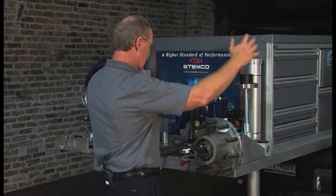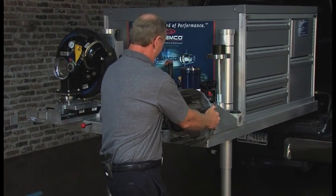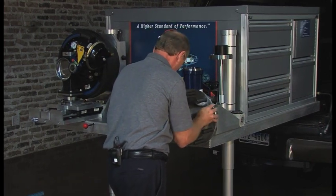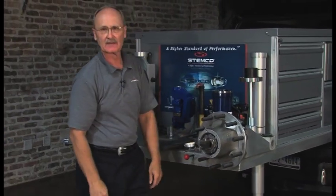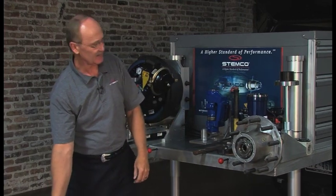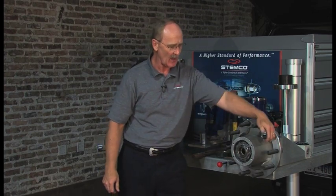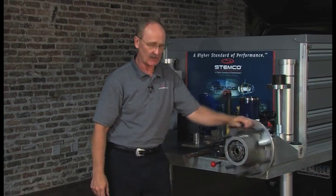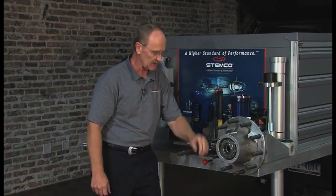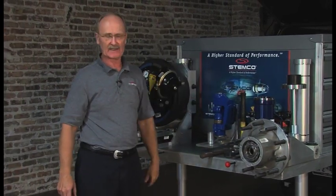All you do is grab the wheel, oscillate it, pull towards you, hold it; then push away, oscillate, hold, stop, and read it. But the dial indicator is not the final check. The wheel has to turn smooth, quiet, and free without any hesitation. If you rotate the wheel and hear a pop — you've got a problem. If it stops — you've got a problem.